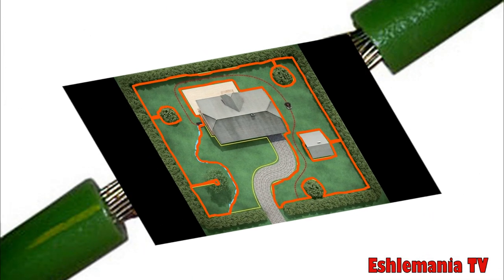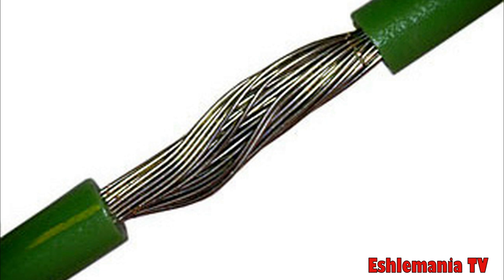Once you've narrowed down which section of your yard has the broken wire, the first thing you want to do — especially if it involves a perimeter wire — is check the end of that wire at the charging station. Make sure the connector isn't corroded, rusted, damaged, or frayed. If you have enough slack, just put a new connector on. I've seen guys pull their hair out for hours when it turned out to be a bad connection right there at the charging station.